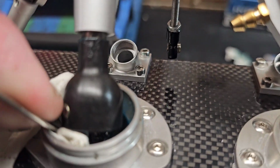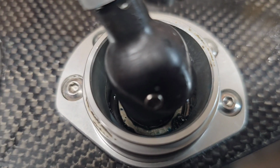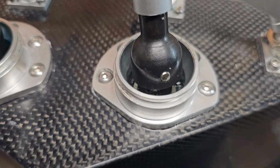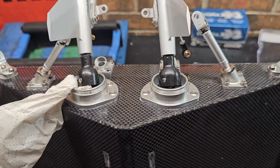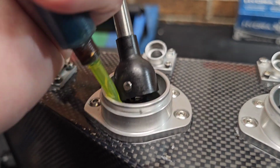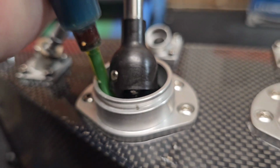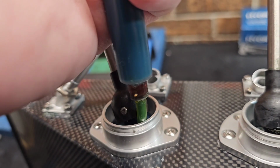All right, I figured I'd make a little clip of cleaning this out. I actually did find something interesting. You see in this one, it's got a snap ring in there too. That's what holds it in place. So we're learning how our boat works. It's very important that you know how your boat works inside and out. I don't know if I can do this one-handed. I got the camera in the other hand, so I got my grease here and put a little tube on there. I'm going to push grease all the way around that bearing right there.